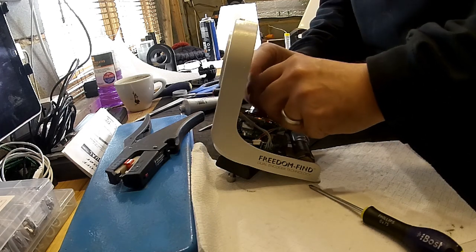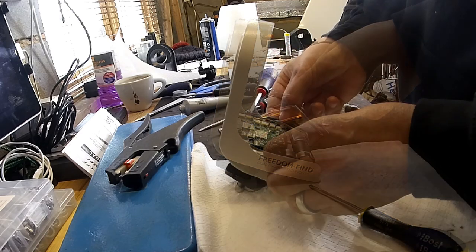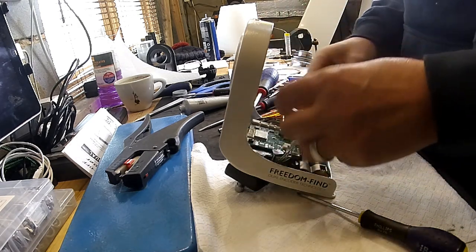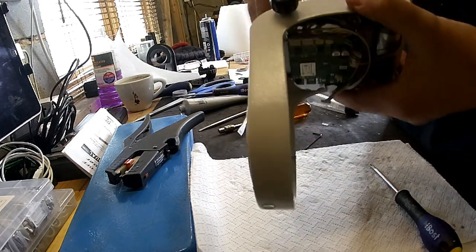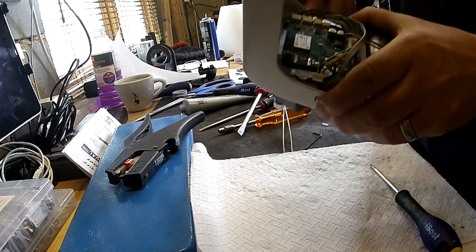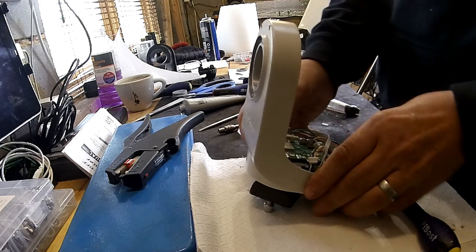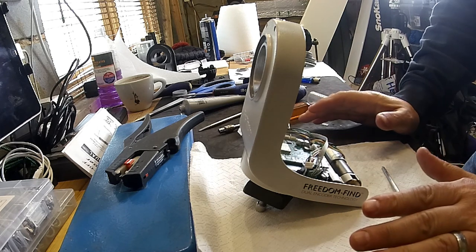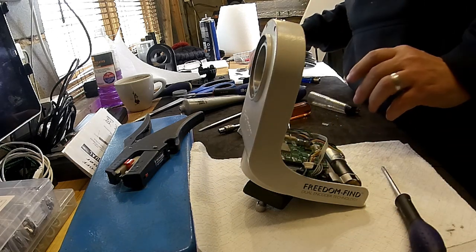This plug needs to go back in and that clicks in there. That's for the other motor on the declination side — that's the RA side put together. It's nice and smooth. Clutch is done up — that's good. One thing I wanted to look at: with the motor pushed in I'm going to have to run it and see whether there's any binding. If there is I'll have to release it a little bit, so I won't be putting the main cover on just yet.